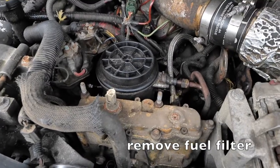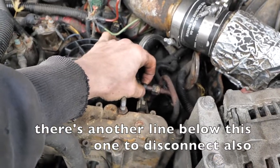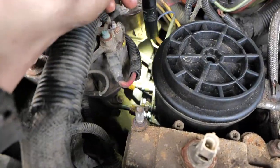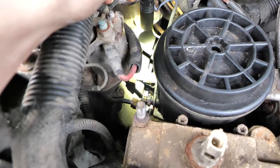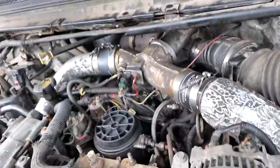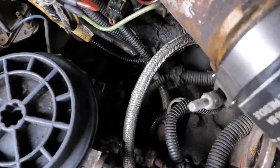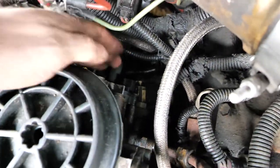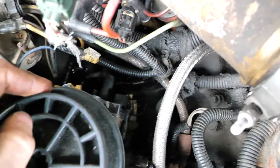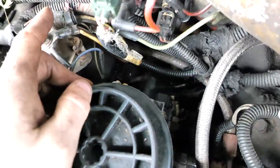I'm going to show you everything still kind of semi-installed. This is a really easy nut to release. This thing right here that's black is just rubber. The other lines to it are the same. You can see I'm shining these two lines right next to each other — they're disconnected and they also have rubber on them. There's a sensor back here. The yellow harness right here, which you squeeze from the sides to get off. The drain hose just pulls off in a direction towards the cab and comes right off the drain cock.